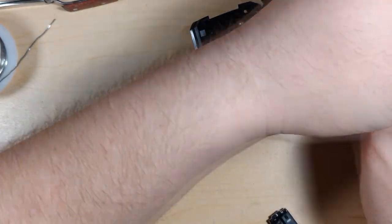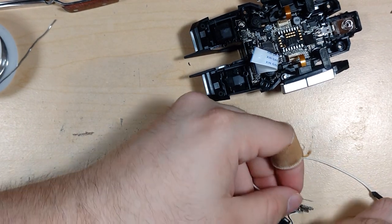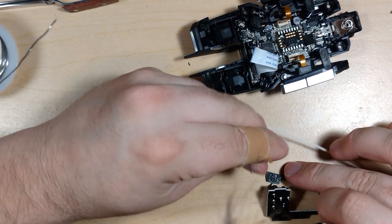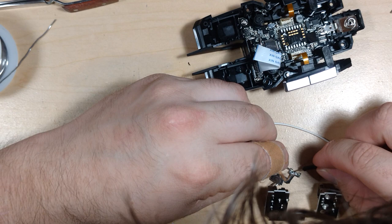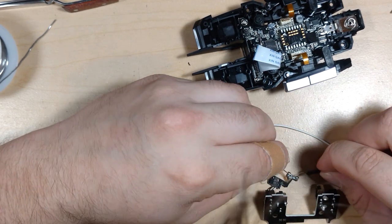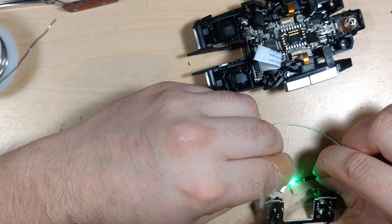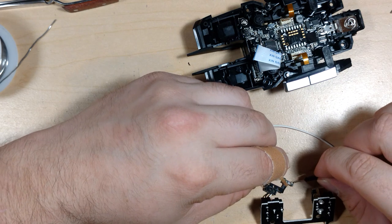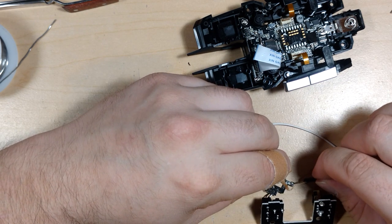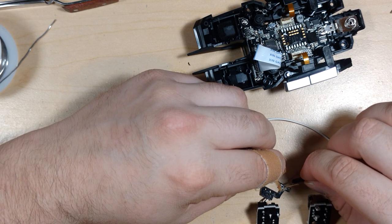I think I tested the polarity on these, and they're inverted from each other or something. See, so my right hand I have positive. Okay, yeah. And you can see these are nice and bright, but also the resistors are right by them, which is going to make this tricky. So positive is on the outside of them. Basically, positive on that side, on the right, and then now this one positive is on the left.